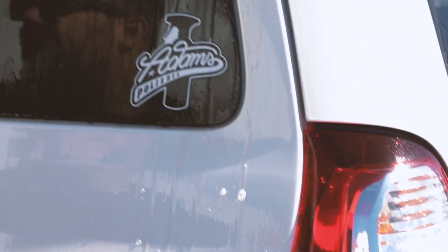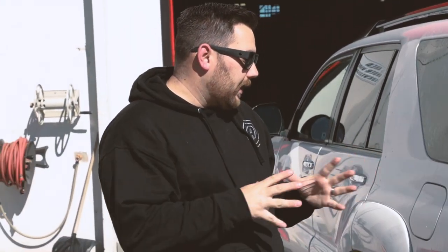I thought I'd have to do it again and actually it's showing me it worked on the first round. I just wanted to show you guys — I was washing my car yesterday — how well iron remover works. It's a really good seller for us and it works really well. To reiterate: this is a tool to help get embedded metallic contaminants and rail dust out of your paint, but I still recommend clay barring your car after an iron remover treatment. Once I'm done I'm going to clay bar my whole car because I'm getting ready to polish and ceramic coat it. You can do iron remover after you've washed and rinsed your car, go around the whole car, rinse it off, then clay bar it.